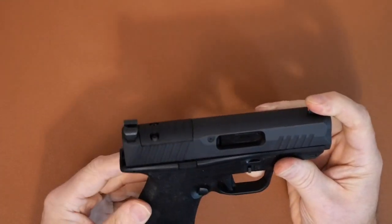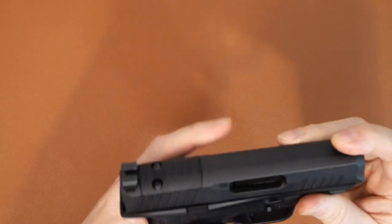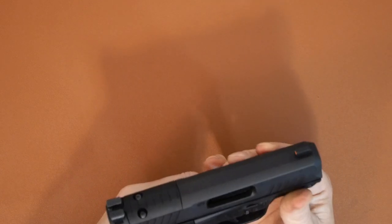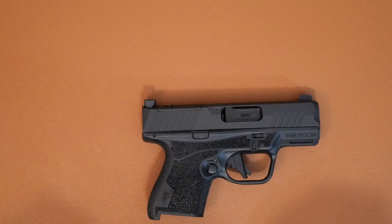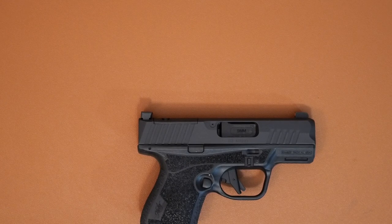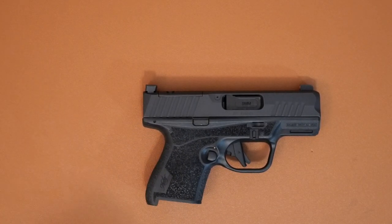There's a slight angle — you kind of have to put everything at a slight angle, then just drop it in, press it down, pull it back, and you are good to go. You've got to have it at a slight angle; it's not a straight slide-in. You've got to get everything lined up — the cam lug into the notch — and have the recoil assembly at a slight angle. Hopefully that was helpful! If you like this, please give it a thumbs up and subscribe.